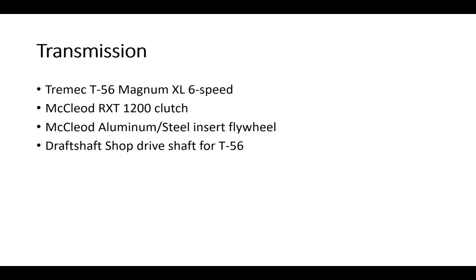For the transmission, I went with the Tremec T56 Magnum XL. It's a 6-speed rated at 700 foot-pounds — that's continuous operation. So basically, if you're stomping on it continuously, it's rated for that high horsepower. For transient response and shorter duration loads, it's going to handle much more than that. It was supporting over 1000 wheel horsepower pretty easily, so far so good.